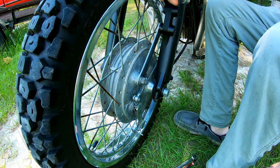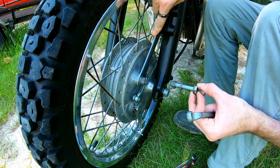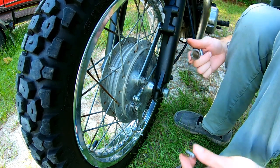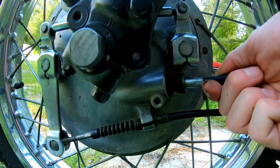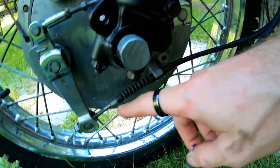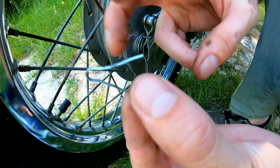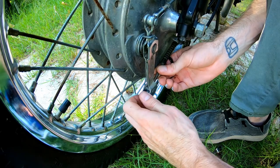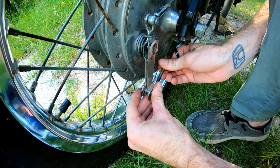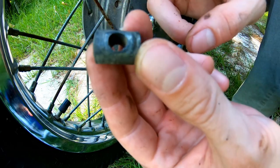I'm on to the tire. I just removed this bolt — this is a tie rod, I would call it. It ties from the hub to the fork. I just removed this speedometer cable — speedometer cable pops right out, one screw. Now to unhook your brake, you take out the pin on the end of the cable, or safety clip, whatever you call it. There's a nut on the end of that cable that threads right there. Pull the cable out and there's a little block, a little guide, whatever you want to call it.